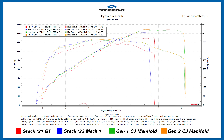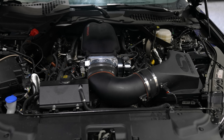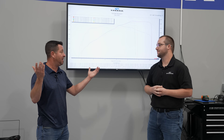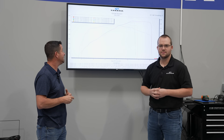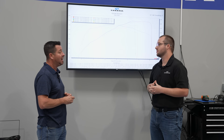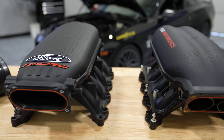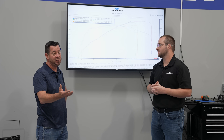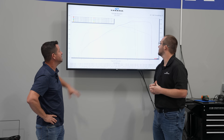The new intake looks a lot cooler — it's a little more lower profile, fits underneath the stock hood a little better. It was out of stock for six-plus months. You can't deny the looks — the looks are fantastic. Better packaging, so to speak. The plenum volume may not be as big and some of the casting looks like it may be cleaned up, but if you want a Cobra Jet to make top-end power without sacrificing anything down low, it's a home run.